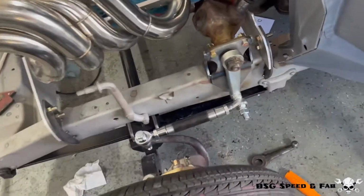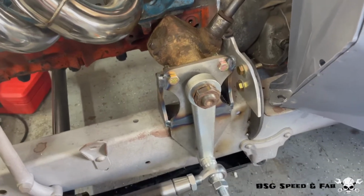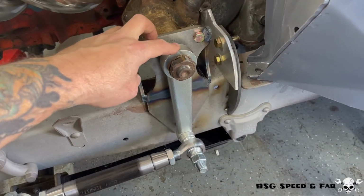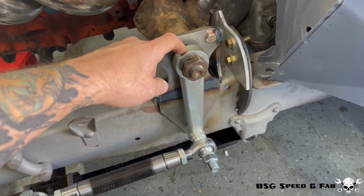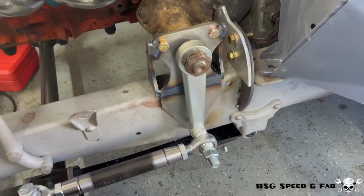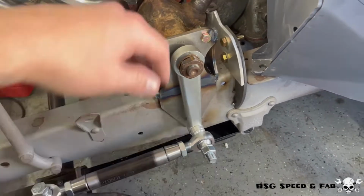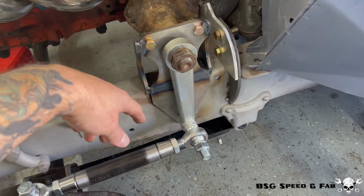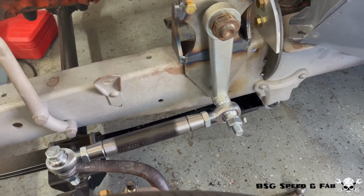I'm really liking how the steering is turning out so far. As you guys saw, I installed the steering box. I got this longer pitman arm installed. It's 1.5 inches longer than stock, and it's actually for a Chevy pickup truck. I'll put a link down in the description of the parts I've used so far. With this being longer, it's going to help with the steering ratio, so essentially fewer turns lock to lock.